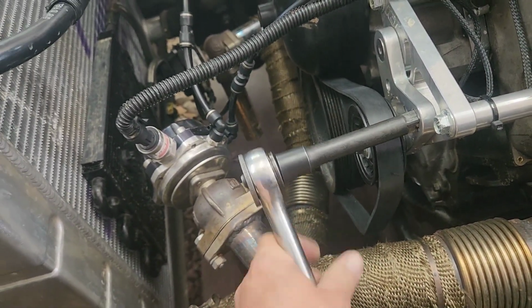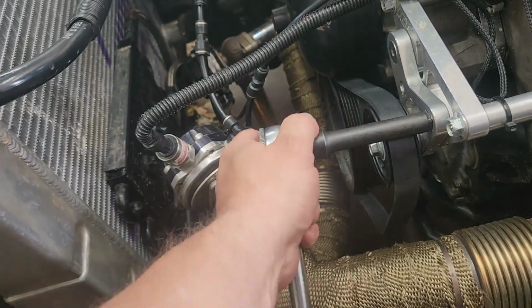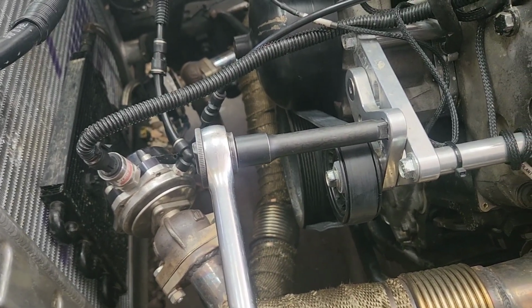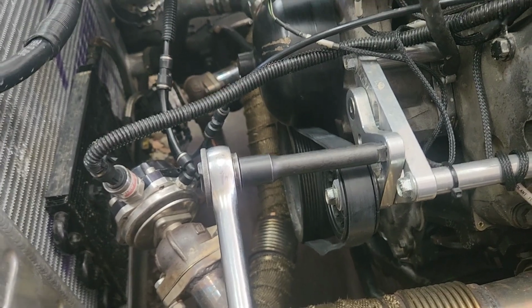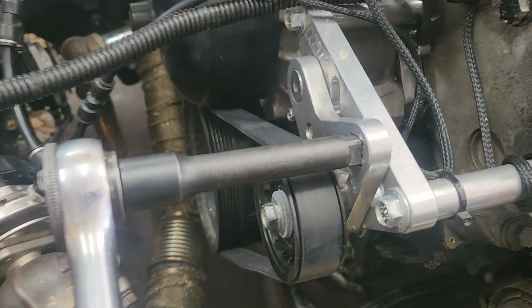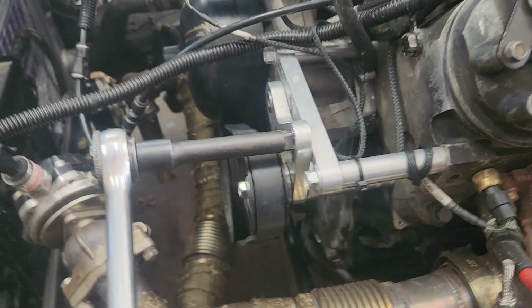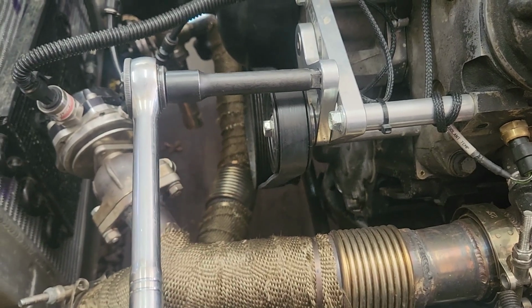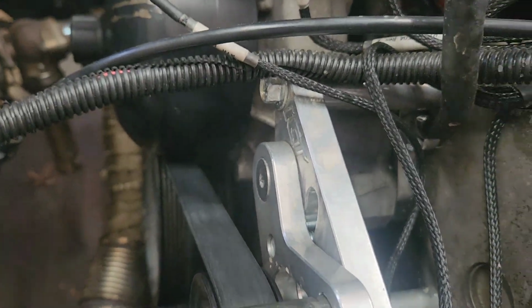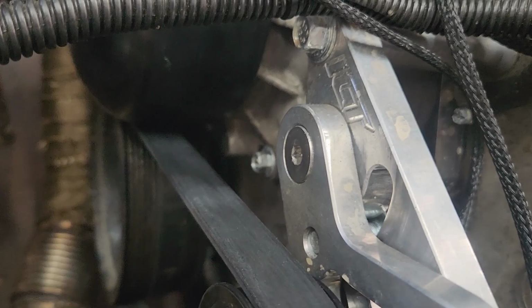Yeah, look at that. Tons of adjustment. So TJ runs a 63. That's a 61 right there. Probably could have even gotten by with a 605, 60.5 inches. Anyway, with a 1/2 inch drive, you got to use an extension because you won't get the head past that. Make sure you're all in the grooves all the way around, and then pull up on this. It doesn't take a lot. Pull up on this, and then we'll tighten the nut. Actually, I'm going to tighten that first because that countersunk kind of lines everything up.